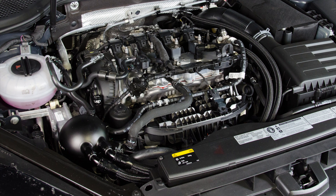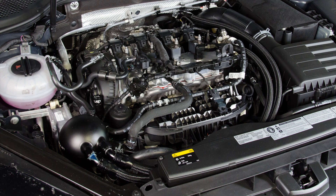The spool and spherical catch can kit replaces the factory PCV valve with a CNC billet aluminum adapter plate. The adapter plate routes the pressurized air into the inlet of the catch can. Once the air enters the catch can, it goes through a series of baffles that separates the oil vapor from the air. The vapor remains inside the catch can and the clean air exits and is routed back into the engine's intake.